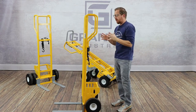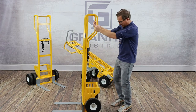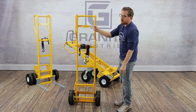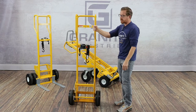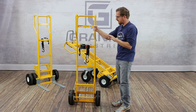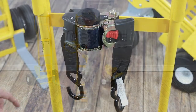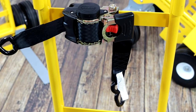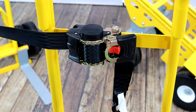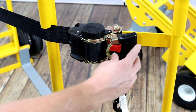Another important thing when hauling heavy, oversized loads is making sure it's properly strapped into place. That's another innovation we've introduced: an auto-retracting E-strap. If you watch me operate a standard ratchet strap, you'd think I hadn't graduated sixth grade — this takes all that complexity out of the equation. To operate your auto-retracting strap, you start by just pulling on it, then looping it around to secure, and then to retract it, you just press the button.